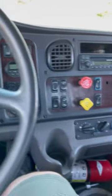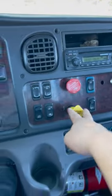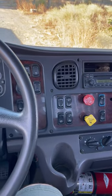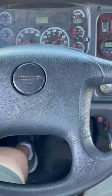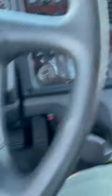My next test is the parking brake. Put it in a low gear, release the trailer brake — we're checking the tractor brake. Let it roll a little bit and feel a tug: working properly. Now check the trailer brake: release the tractor brake, clutch out slowly, and feel a tug — working properly.